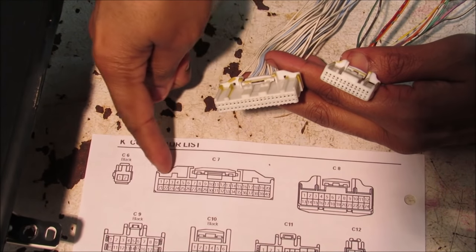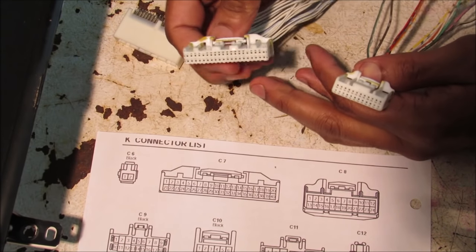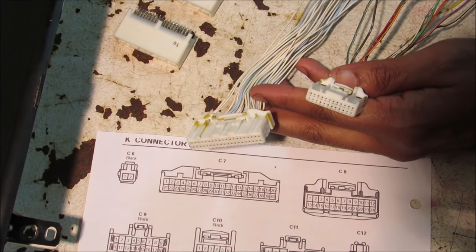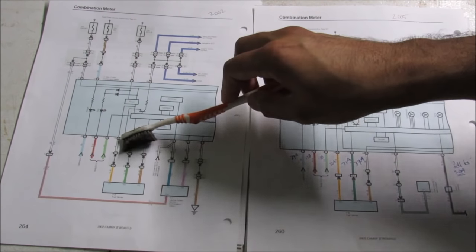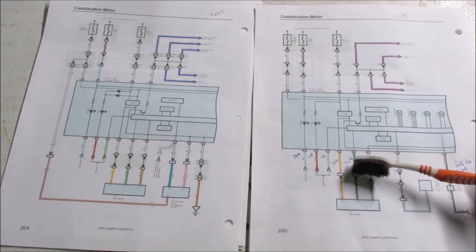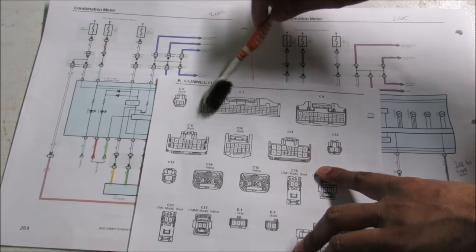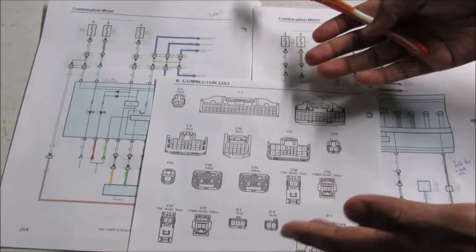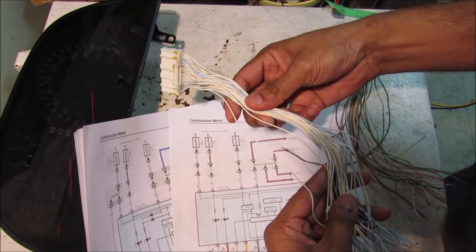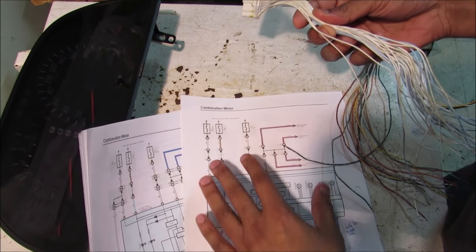From the wiring diagram I have the pinouts labeled 1 to 20 and 21 to 30 for one connector looking at it head-on, as well as a 24-pin connector. For example, the fuel gauge on the old cluster is wired as pins 32, 31, and 39, while on the new cluster it's wired as pins 19, 18, and 40A. So using the pinout diagram I'll know which pins to swap to make the fuel gauge work. I'll post a link to this in the description so you can see it in detail.